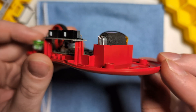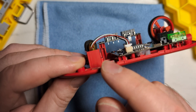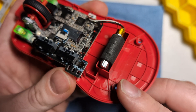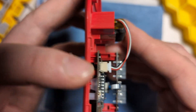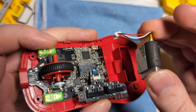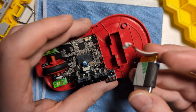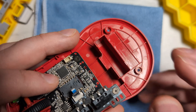Now focusing on the base shell — the first thing you might notice is this rather unique battery installation. The Cloud V1 had a similar method but the battery was on an angle and was much shorter; they've raised it for some reason here in the Cloud V2, which adds a bunch of weight to the unit. The top of the battery is held in by a little brace on the top shell. I feel like there are much better ways to anchor this battery — they could have just laid it flat. Regardless, we'll remove the battery by taking our fingernails on the side of the JST connector, wiggling it off, and pulling up. On my version there is no adhesive so it's very easy to remove, though this may be a factory defect. Unfortunately, due to the sizing of this space, you can't really mod in a larger battery.